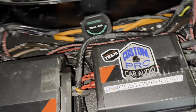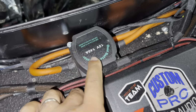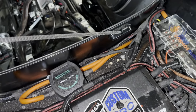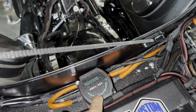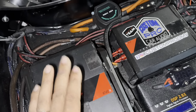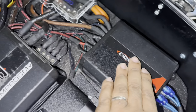In the Torpak is where we have the biggest mistake. So they're using a 140 amp isolator. The issue is you have a lithium under the seat, a lithium in the Torpak. So I have a small lithium in the Torpak, big lithium under the seat. They're using a 140 amp isolator. This amplifier by itself draws more than 200 amps of current. So just this amp will overload this isolator. Never mind this one, and this one.